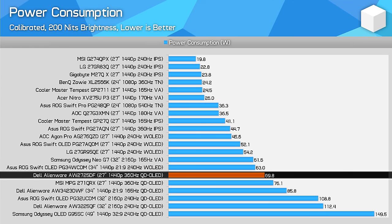Power consumption is interesting because the Dell monitor actually came in consuming about 6 watts less than the MSI model at the same 200 nits of full screen brightness. This is still less efficient than competing 1440p W OLEDs though, which benefit from a white subpixel — the AOC AG276QZD uses 35% less power in this setting, and the best LCDs for efficiency will use less than half the power. This display doesn't always use 70 watts; for example, opening Steam shows about 26 watts as it's a much lower APL image, but that's still not quite as efficient as the best monitors. QD OLEDs are power hungry.